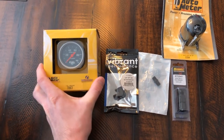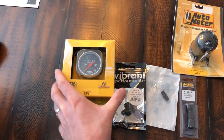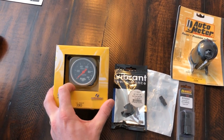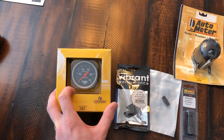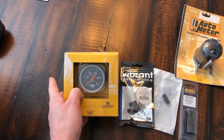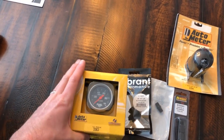The FiTech does not monitor fuel pressure. I have a fuel pressure gauge under the hood, which is great if you're standing there looking at it while it's idling, but when you're driving it's also good to know what it is. I haven't had any problems with fuel pressure at all, but in case it ever does start giving me problems, this is one of the very first things you want to look at diagnostic-wise. The FPRs do go bad - I carry a spare one. This will give me a good indication of whether I've got something going on: bad FPR, bad pump, or clogged filter.